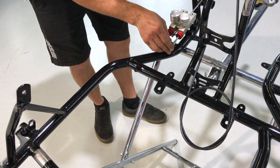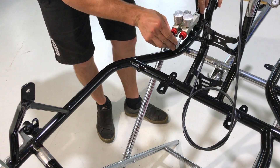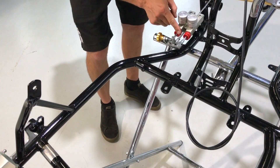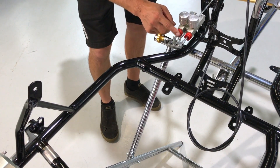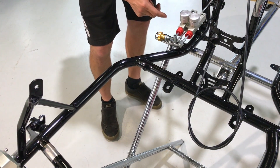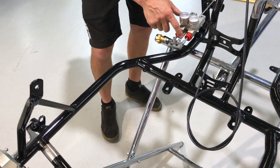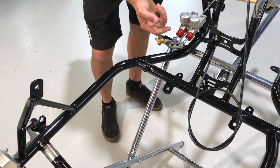The brake rod spins into the piston actuator. This is adjustable for length depending on where you've got your pedal — up to a certain point. You can buy all-thread and cut your own rod, or use the standard chrome one. Note that the standard rod diameter is actually smaller than 6mm so you can't add more thread to it.